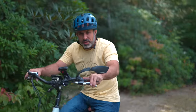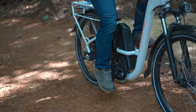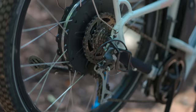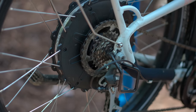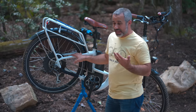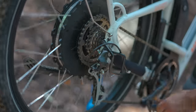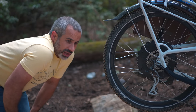With this newfound knowledge, maybe we can figure out what's going on with this bike. This is my father-in-law's e-bike — it is all business, you can tell by the stack height. Not only does it shift like garbage, but it actually pedals like garbage. Let's start with a visual inspection. It's a little dirty but I don't see anything that's worn — you can still see the cassette is nice and shiny. The bike's not that old, so we can rule out that everything is worn out just by looking at it. Let's pedal it and take a look. I can tell by where the shifter is that it is supposed to be in the lowest gear, but it is in the second-to-lowest gear. Cable tension is probably the culprit.